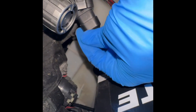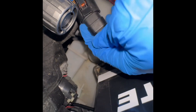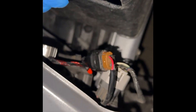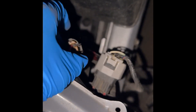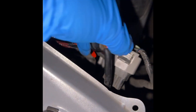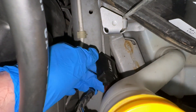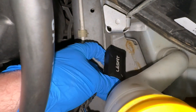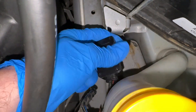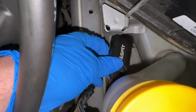Next I connect the old connector to the new clip — it should go right in and make a satisfying click. One thing I want to point out is that polarity does matter. These LED bulbs can go in either way, and if they are not turning on, just flip them the other direction in the connector and it should work. Now I have this control box kind of floating around the engine bay. I might want to zip tie it somewhere or put it somewhere where it won't get too hot, because it does have high temperature output, so just keep that in mind.